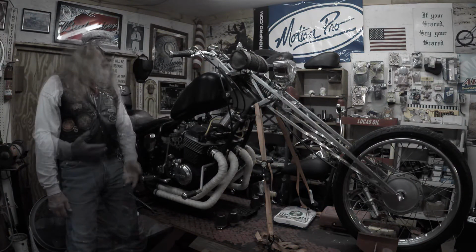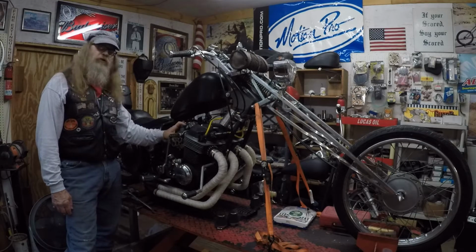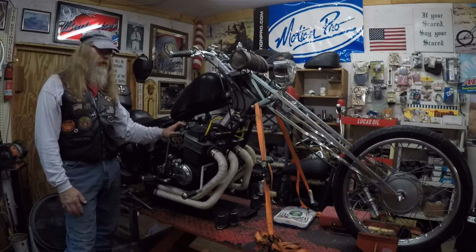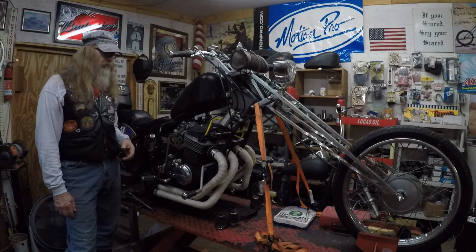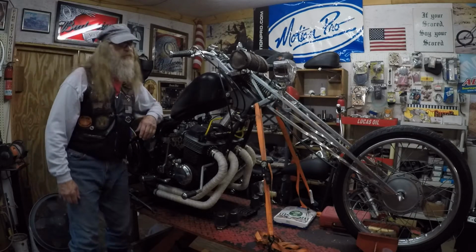So, like I said, I gotta clean the points, set the dwell. I gotta go through the carburetors just to make sure they're right. Put a new battery in there, give it a couple kicks, we'll fire right up, and we'll be back in business.